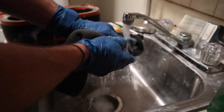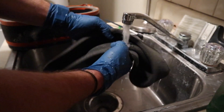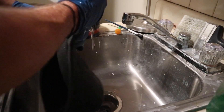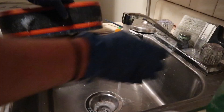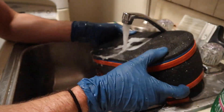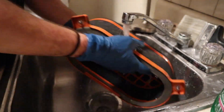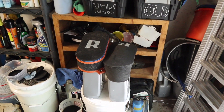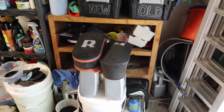The pre-filter — I've already got most of the soap out of it; this one's pretty easy. I have a feeling the main filter will be a little bit more difficult since it's made into that frame. You can squeeze the water out — do not wring it. You take the chance of tearing the filter if you wring it. The next step, though it's the easiest step, is also probably the longest step: we need to let these bad boys dry out. Once they're dry, we can re-treat them with oil and get them back on the bike.